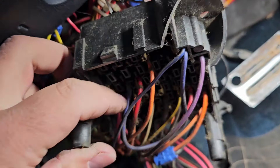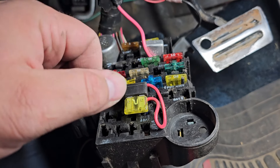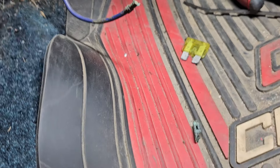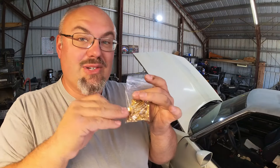This blue wire right here is the one I'm after. Given that I've also got some other issues that were corrected many years ago — corrected bunny ears — I'm going to take a look at this and make sure I know what I'm doing next. I pushed on it with a flat blade screwdriver, just ever so gently, and it popped right out the back of the fuse block. I have these little connectors that I found on Amazon — my local NAPA couldn't find them, nobody could find anything that was going to work. I found this listing, and reviewers said they were fixing an '83 Caballero — same car. I've held it up to what's left of the connector and slid it into the back of the fuse block — it looks like it's going to work absolutely perfect. I'm going to solder this in because there's not a ton of meat there. There'll be a link to these connectors in the description.